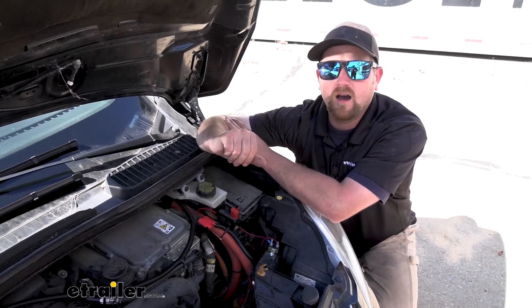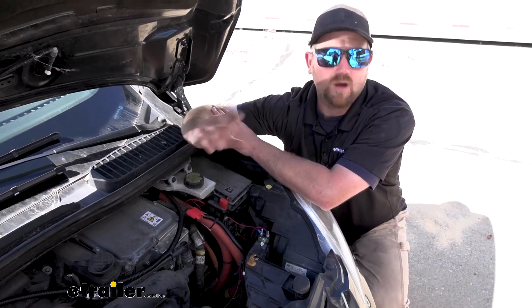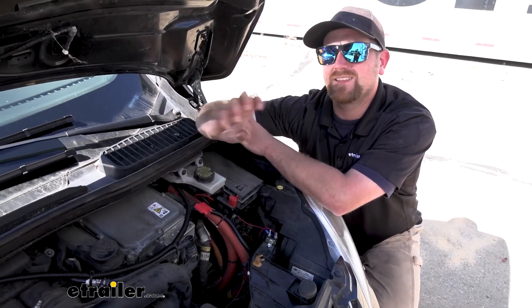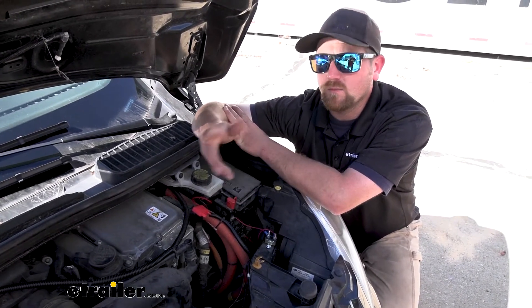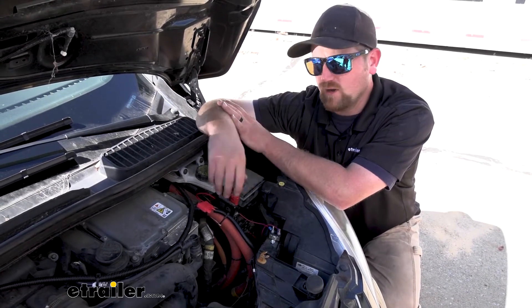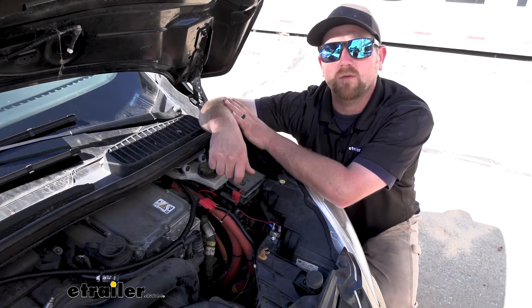You are going to have to have that 12 volt auxiliary power already hooked up to your 7-way. Generally speaking, if you have a 7-way, that's already there, especially on these late model motorhomes. If you have an older motorhome or something like that, just make sure that 12 volt power is there at the 7-way, and then the charge line kit will work out for you.